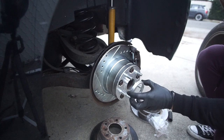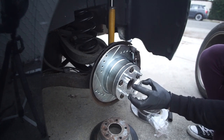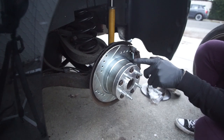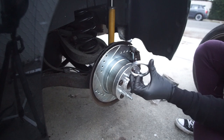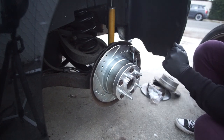Make sure that when you do your wheel conversion, always get the hub centric ring so your wheel sits on top of it. It's all about safety — you don't want your wheel to flap around the hub, as that could cause damage to the lug nuts, break them, and have your wheels fly off. Use your hub centric ring so your wheel sits nice and snug.